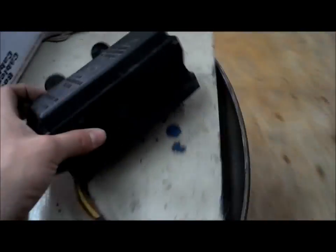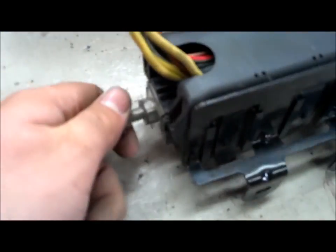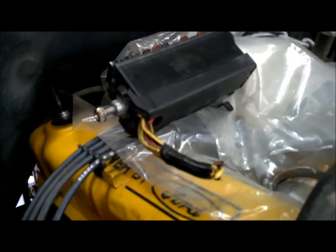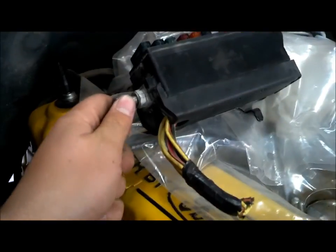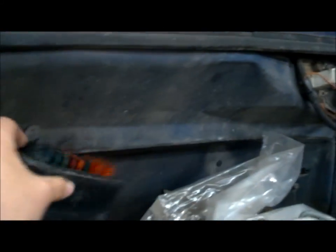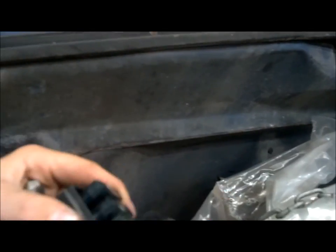We have this main power distribution box I pulled out of a Ford Taurus — it's pretty nice. Open it up and you've got big heavy fuses, big heavy wiring, and a bolt that's your main power lead. We're going to bolt that up on the firewall, run the hot from the alternator up to it, connect the jumper cable wires, and run them down the frame. First step is figuring out where I want to put it on the firewall so we can wire everything accordingly.